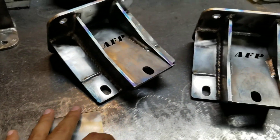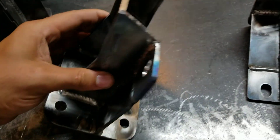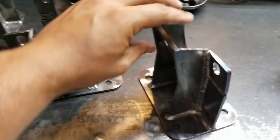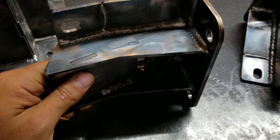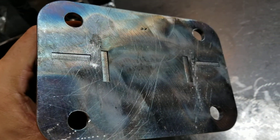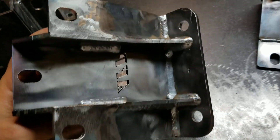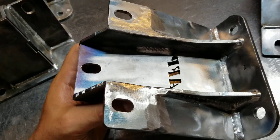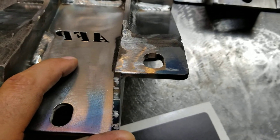The motor mounts are more of an issue on the 07 to 14 LS trucks since they changed body styles — that's what this one fits. Same deal as the 99 to 06 one, but it's a different shape and entirely different size with the same basic concept. They're all 3/16-inch thick welded steel, laser cut, fit together very nicely, welded inside and out — like I said, probably overkill. The reason for these grind marks is I grind them flat so they sit flush against the frame; I actually weld the bottom then grind it flat so it sits nicely.